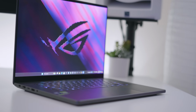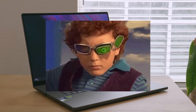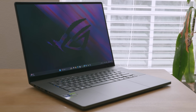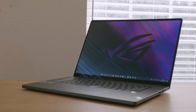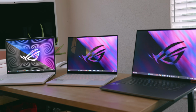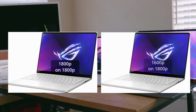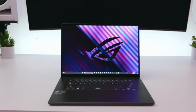I still think this is the sweet spot for laptop displays at 16 inches, as any resolution above that is really hard to notice, except maybe in text and some small icons, and those higher resolutions will absolutely tank your FPS, like what we're seeing with these 2000p displays, or 3.2K, whatever they call it, in many Lenovo laptops, and even the new G14 with its 1800p display takes a hit to FPS because of that. And of course, reducing those to 1600p will unfortunately not be as sharp as a native 1600p panel. So to me, that's kind of a lose-lose situation for now, at least in 2024.